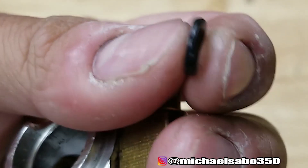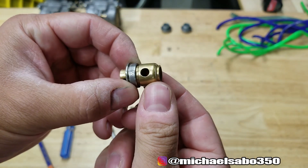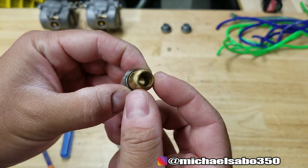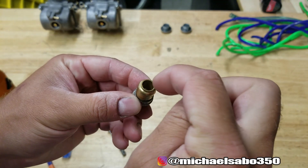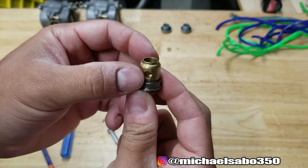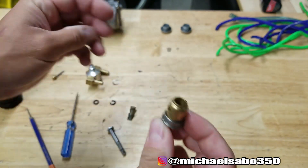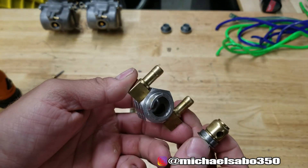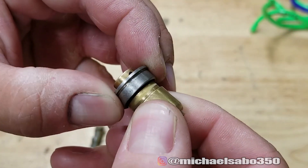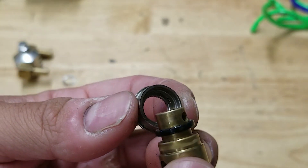This one looks good but we might as well replace them both. Here is the section that opens and closes the valve — so depending on how this is lined up, it will dictate whether or not it will flow. It looks like the gas comes down through here and then comes out these two holes, and if these two holes are spun in the correct orientation with the two ports, gas will flow. And we have another o-ring right here — we might as well go ahead and replace that too.